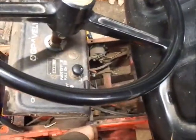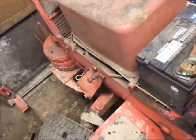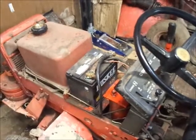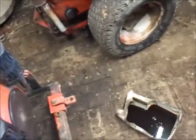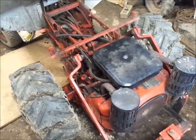It might be a little overfull. Let me crank this thing up. Now hold back on the valve and she's fairly fast. Slower at idle and fairly fast when revved up — that's about how I'd expect it to work. Pretty good to go there. I haven't done anything with the steering yet — that's going to be the next thing. Tightening up that rod wasn't a bad thing, and changing the hydraulic fluid was definitely the main fix.